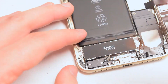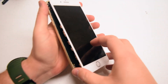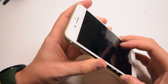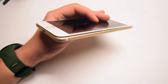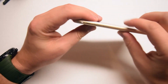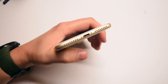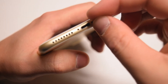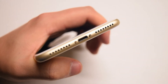Put the cover over the connection in the correct orientation and secure it with the two Phillips head screws. Now we can clamp up the phone — go ahead and fold it up. At the very top, make sure you tuck that in first and the latches are in at the top, then clamp it shut. Go around the contour making sure it's sealed and clamped in. Once you've gone around the contour a few times and have a good seal, reinstall the two pentalobe screws near the charging port and tighten them with the pentalobe screwdriver.